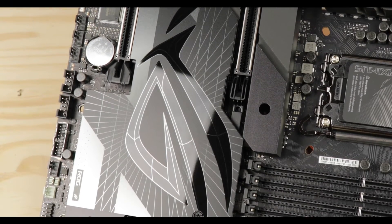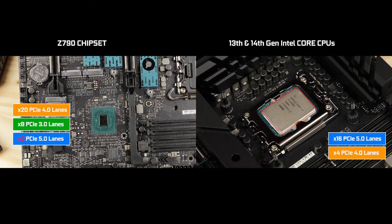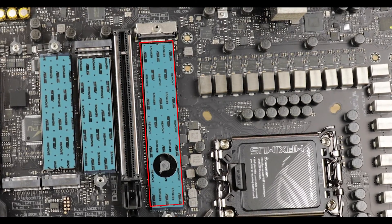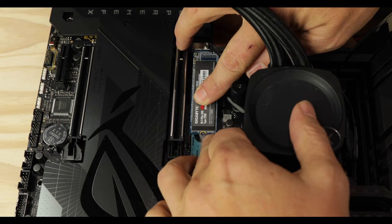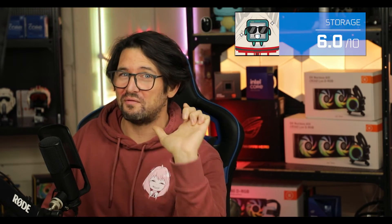My second not-so-good point is less about Asus and more about Intel: the CPU/chipset PCIe 5.0 lane availability. We only have 16 PCIe 5.0 lanes, and what happens is we can end up with very cruel PCIe bifurcations. If you ever try to put an M.2 stick in the PCIe 5.0 slot, your board is entirely transformed — an in-depth PCIe 5.0 bifurcation sends it straight back to Prime Pro-level abilities, since not only does your second GPU slot go completely dead, but the first one drops from x16 to x8 PCIe 5.0 lanes, completely robbing it of its future-proofing abilities. You really have to read the fine print to know this, and I find it quite deceitful from both Intel and Asus.